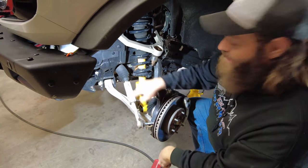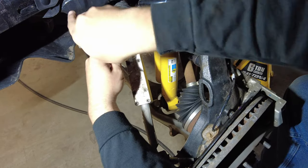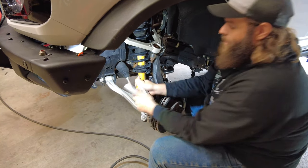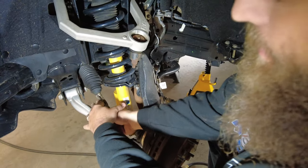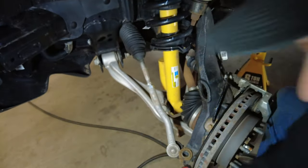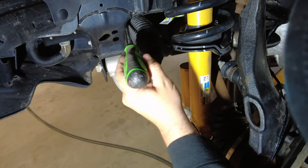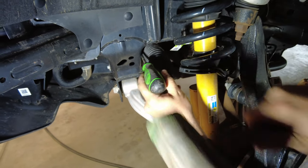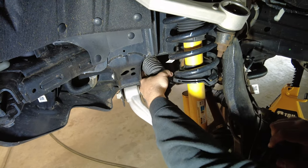Let's track down some Allen wrenches and get that buster brace out of the way. Now that we've got our buster brace out of the way, we're gonna remove our little clamp holding on the outer portion of the boot. Take a flat blade screwdriver, stick it in right on the lip of the clamp that's already in there, smack it, and that should break it right off.